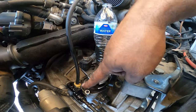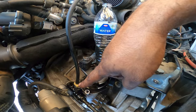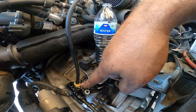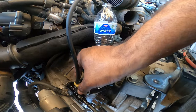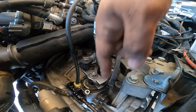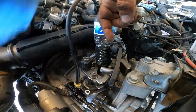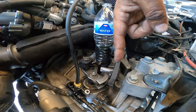You're going to run the little hose to the nipple on the bleeder valve right here on the clutch slave cylinder — or the throwout bearing, in this scenario. On Mark 7s, you have this little twisty thing here. On Mark 5s, 4s, you have to use a little wrench to do this. This process is very similar to all the cars I've ever worked on. If you guys have a better option, please put that in the description below to help others with future DIYs.